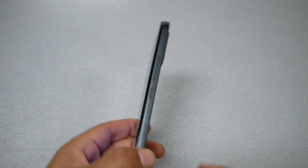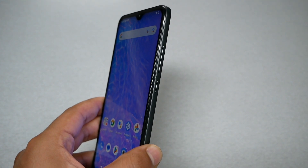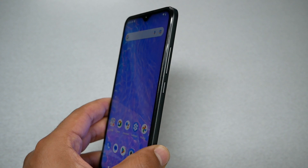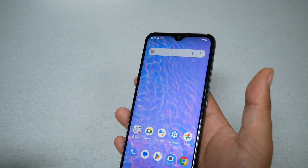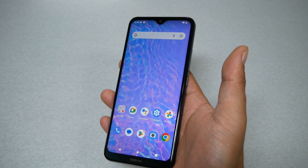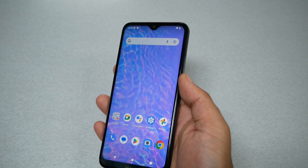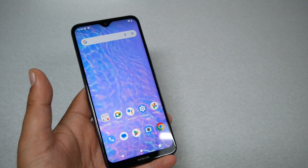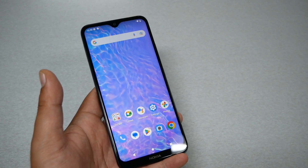What you really need to do is press and hold the power key only for around 10 seconds or maybe more. The best sign is when you feel the phone vibrate in your hands — you'll normally get the Android logo, which means the phone is rebooting. Remove your finger at that point, because if you keep holding without paying attention, the phone will keep restarting over and over. When the phone vibrates, that means it's disconnecting and reconnecting the battery.